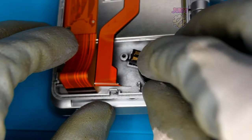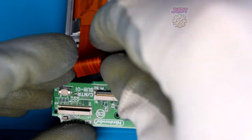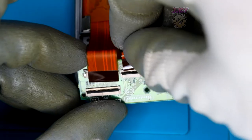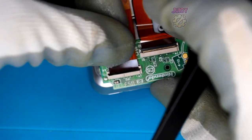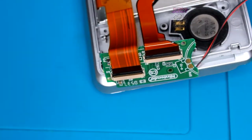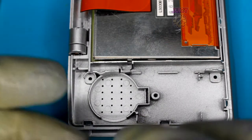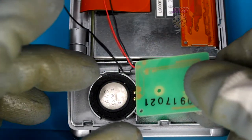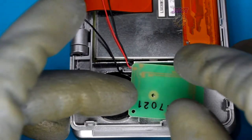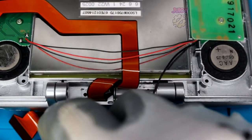Now that's through, push it all the way and let's get to placing the speakers. Put the speaker back in, then put the board back in - connect the cables back up, lock them in place, put the board in. Flip the board back underneath, put a Phillips screw in the screw hole. Moving to the other side, put the speaker in and then the board, which stretches across the screen with the cables, and put a Phillips screw in that hole.